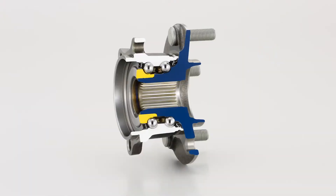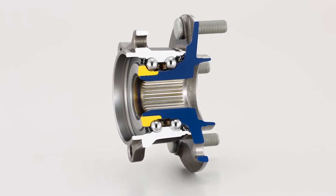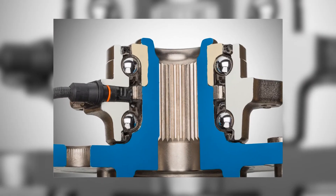With some other hub units, the preload is set at the factory. But it's just as important because you're holding an axle, and if you don't do it right, it causes noise. The splines are what you're going to be engaging. If the hub assembly has a rolled closure, the preload is set at the factory, but you still have an axle nut, so torquing that is important for spline engagement to reduce noise or looseness. The weight of the vehicle and whether it's a high torque or high load situation will also determine axle nut torque.